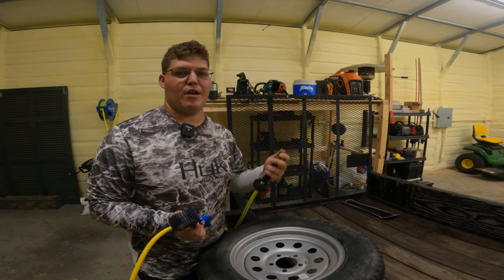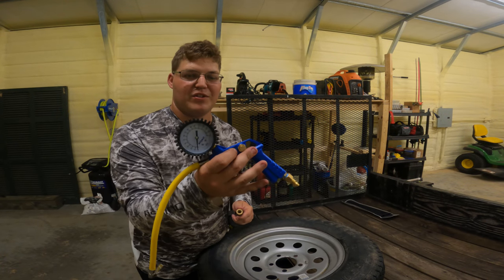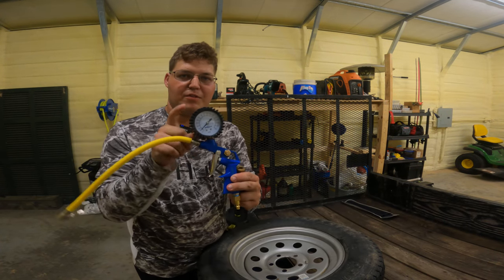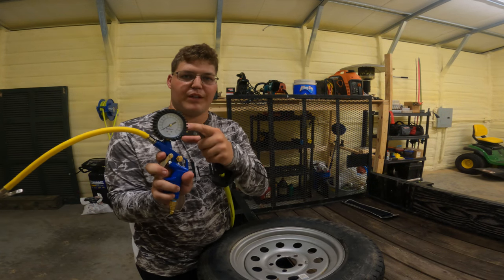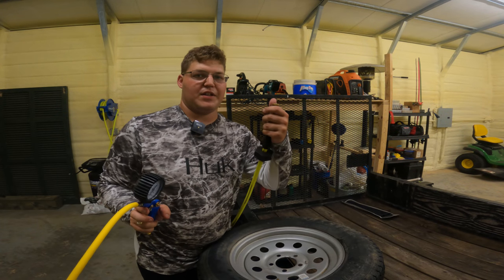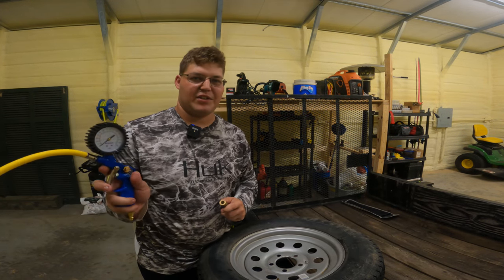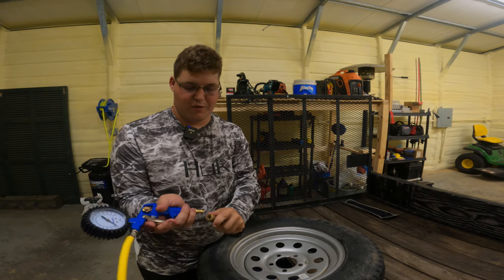If you have more than a couple of tires — say a lawnmower, your truck, maybe a trailer — I highly recommend this tool right here. It's just a little pistol-grip tire gauge as well as a tire inflator, everything built into one. This little pressure gauge, as you're filling the tire up, allows air to come through, but when you stop it'll read the pressure of the tire itself. So instead of constantly switching between a tire inflator and a tire pressure gauge, this tool makes it a lot easier, and they're relatively inexpensive. I'll make sure to link one up here as well as in the description.